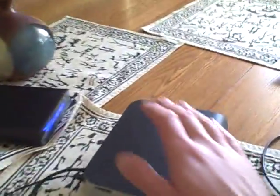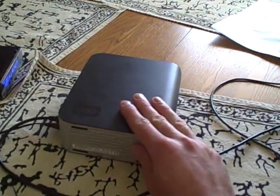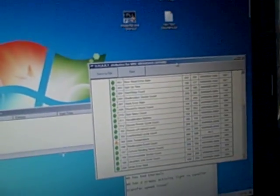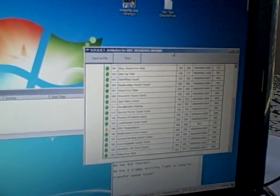That is very hot. Now I have it flat, which is the way most users would probably like it because it is more stable — it can't be knocked over. But this is not how they designed it for best thermal efficiency. Let's see how hot it is running now. I am using HDD Scan to re-ping the SMART data. 49 degrees Celsius. It will probably climb up to 50 degrees Celsius in another 10 minutes. At the end of this review I will give you the final number if it gets any hotter than 49. At any rate, it is not a good thermal design.